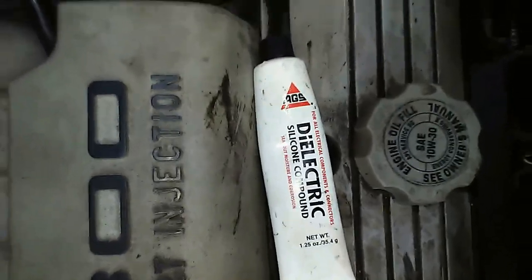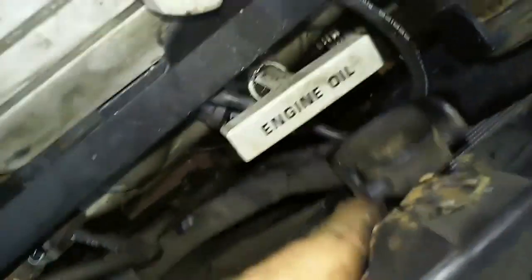You want to see your fans in here — see those two slots right there, those are your electrical connectors. Over here is the temperature sensor, and you're gonna want to put some dielectric compound on those. Take this piece and slide it in, then these bolt to those with the washers already attached — 10 millimeter. There are three of these bolted in there.